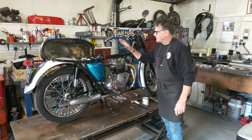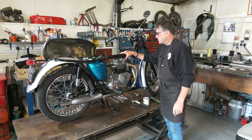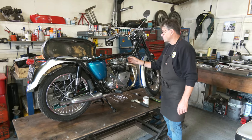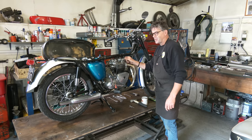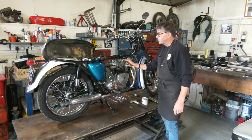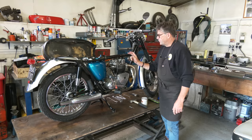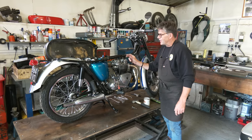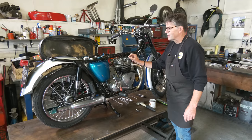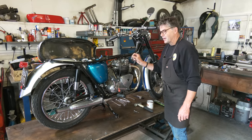Right, new day. Yesterday we thought we'd finish a bit earlier and have a beer. So today, from where we were yesterday, the rocker boxes are on. We're just going to adjust one more valve. They're all the same, these. You make sure that one inlet or one exhaust valve is open, fully open, and you adjust the other side. So it's quite straightforward. Two thou, four thou. But they run on very close clearances, these, so make sure it's not going to be a tight two or tight four thou. Make sure you've got a nice kiss fit.